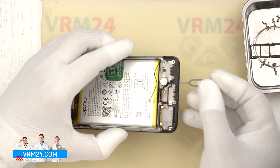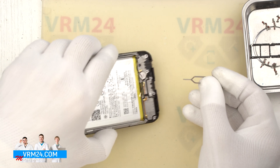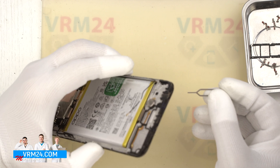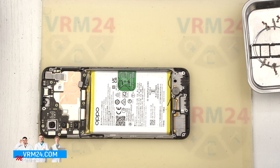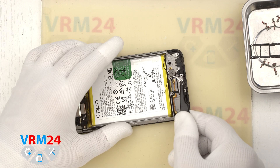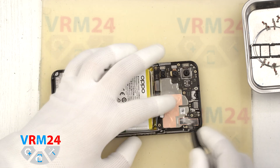The microphone body itself is located on the subboard on the back side of the microphone hole. Accordingly, if we insert something into the microphone hole, we will not be able to damage the microphone in this way. Also, pay attention that the microphone hole is protected by a mesh — it protects against dust, but will not protect the phone from liquids. If we damage the mesh, we will not damage the microphone, but water can still reach it.